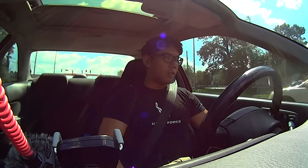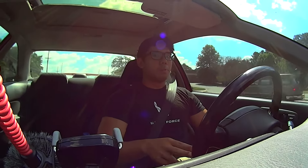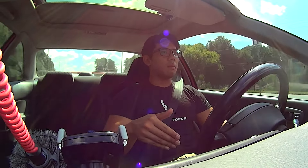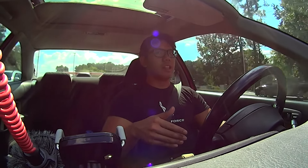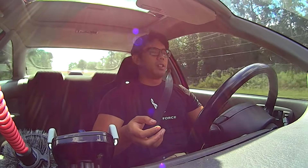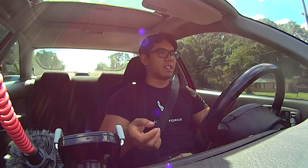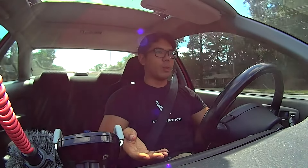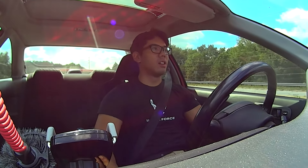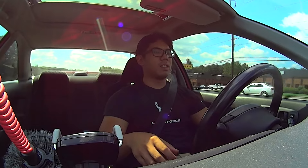To me, I dailied a car that had this exact setup for a long time and kind of got used to it. So when I got this new daily driver, I realized it felt really, really boring. I thought this car had a lot less power than the other car even though they were roughly the same. The whole issue was I was missing out on that raw feeling of just having motor mount inserts in there. They're really affordable versus getting brand new mounts. These are really affordable if you're using your OEM mounts, so you know they're going to hold up — they're designed to a certain tolerance. Versus getting cheap eBay all-year engine mounts, this is definitely the way I would go.